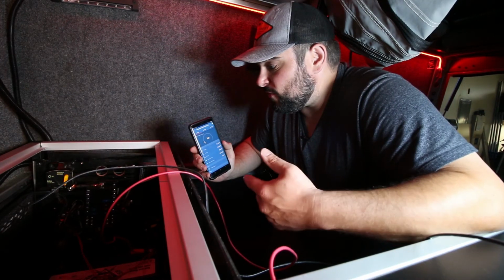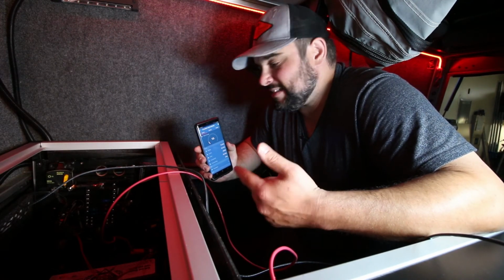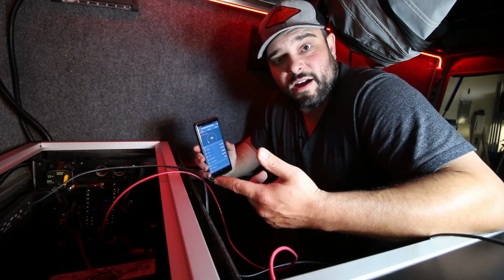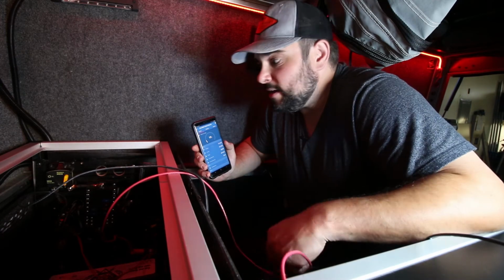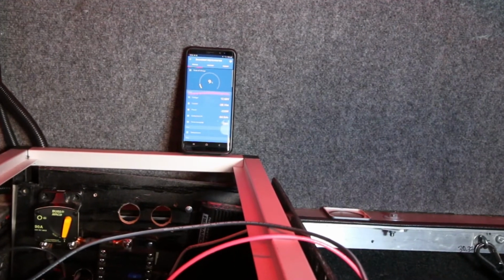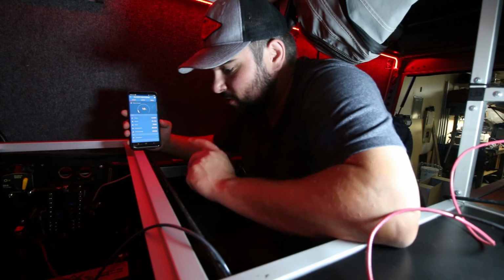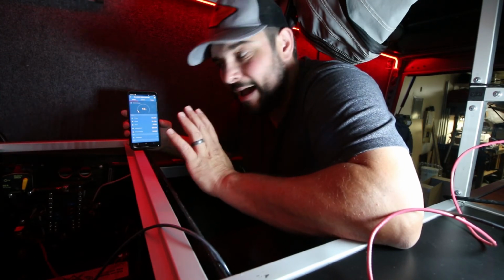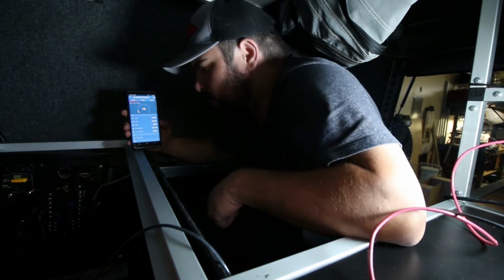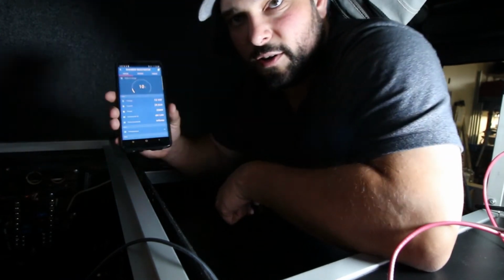I'm going to go ahead and now flip the front breaker that is going to allow the front and the back battery to connect together through the Redarc BCDC charger. I'm going to go up and fire up the truck and see if it starts charging the battery like it should. I'm going to throw the breaker on my circuit panel so it'll cut all power that I have going out back here. So in theory, there should be no power draw on the system right now. We should start to see the voltage coming in, starting to creep up, and the state of charge starting to creep up.